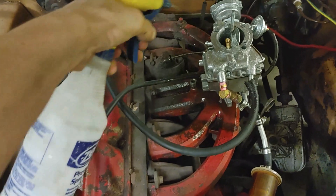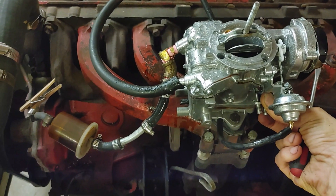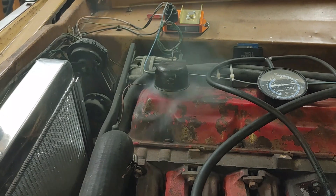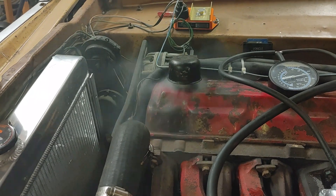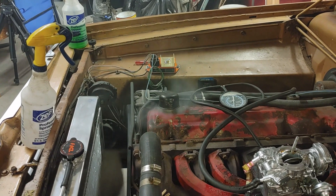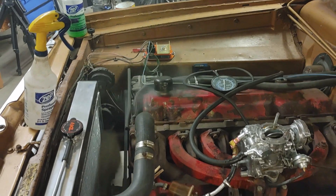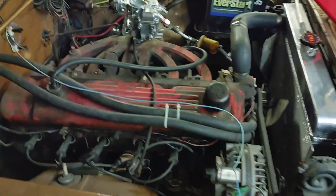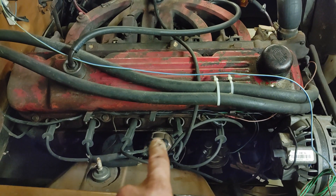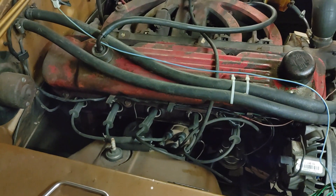I'm going to show you the vacuum signal. That gets rid of all the bugs in there, but that is not good. I don't know why it's doing that. I've got to take a good hard look at what's going on here. I realized that I was dyslexically counting 5 and 6 backwards, so I was 1-6, 3-5, 2-4, which is not the correct timing order — that explains the bad running.